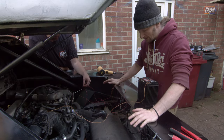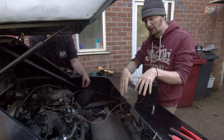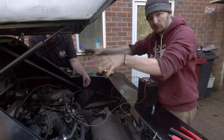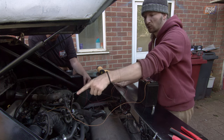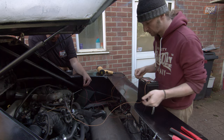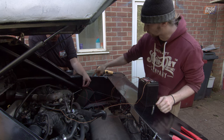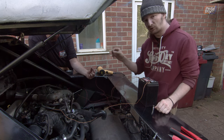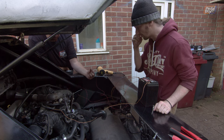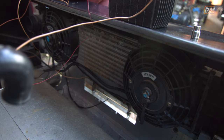In front of me I've got a little bit of a mess — a couple of earth cables and power cables hooked up to our battery. Ignore that it's brown, it is a power jumper, and we've got this here because the connector that powers all of this is in the front left corner of the engine bay where the battery is supposed to live. So we've got power and ground properly hooked up to our relay, and this wire that Adrian's holding is basically what's going to pretend to be coming from our switch in the front of the car — so when he contacts that to the white pin, hopefully the fans turn on.